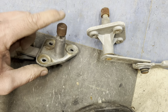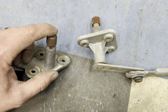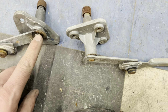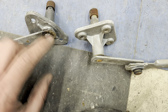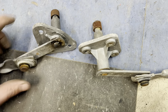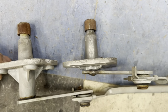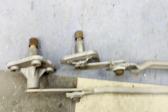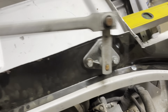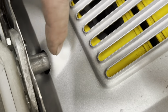So I made this bracket here. I cut down my rod — now you can see the big difference. Everything from here to here is still the same, so from the outside of the car this is still going to stick out exactly how it needs to from the factory. But on the inside, what you will not see is how I cut all this down, notched my metal bracket, and welded it right there so that it can fit in there. You can see a side-by-side comparison of exactly how much more clearance I have now for my defrost vent.